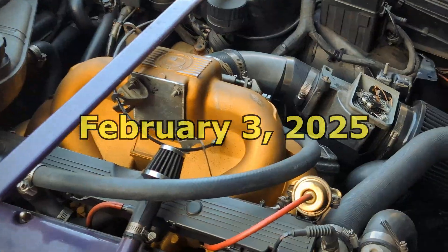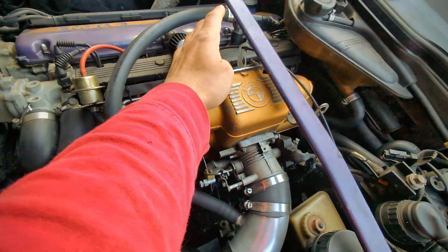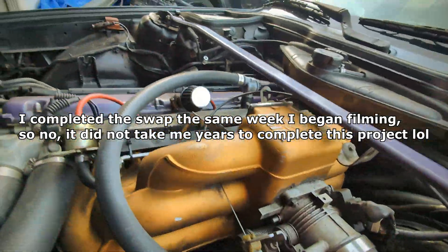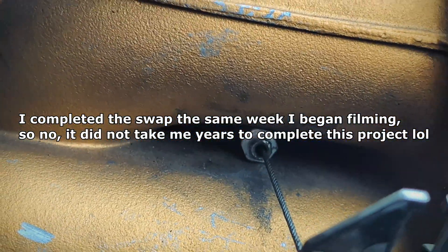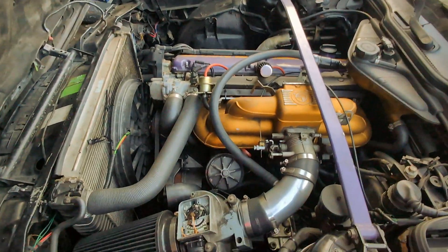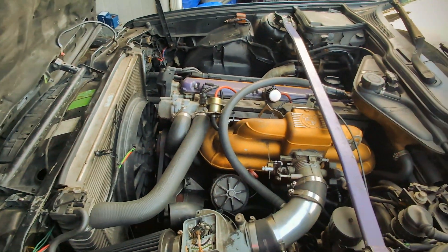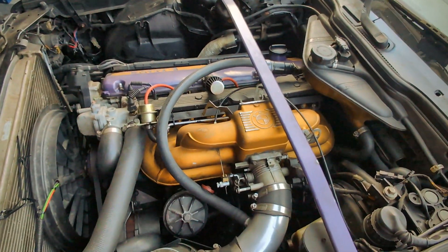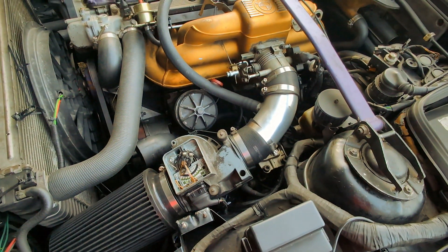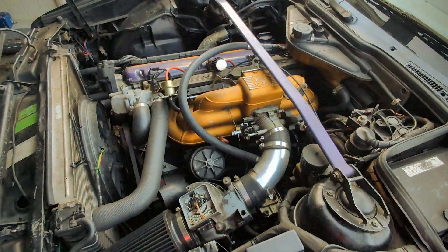Never seen an M30 like this. I didn't get to record me actually putting the manifold in — I didn't think that was really important. What was important was blocking off one side, having the throttle body here, and the throttle cable routed just like Alpina did. I drilled out a small hole in between the intake runners. It's functional — it's not super pretty, don't judge me. I'm getting a new fan shroud; I misplaced mine during the motor swap a couple years ago. I'm going to be running a standalone ECU, so the airflow meter will go bye-bye. I'll also probably run a catch can setup.